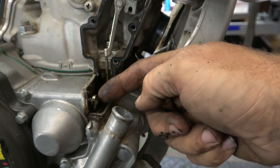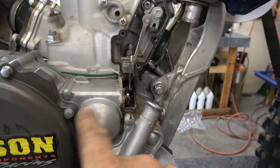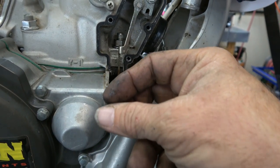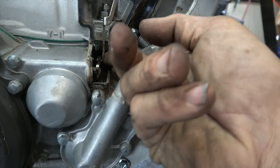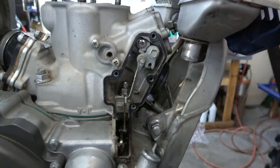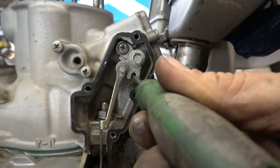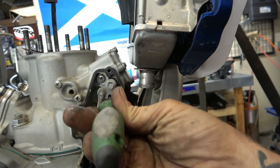The way Yamaha does it: a rod comes down and goes over on a shaft across here. Right here is the power valve governor — it's spinning all the time, and as it spins faster there are little balls that swing out, kind of like a clutch, and they move and lift the power valve, twisting and opening everything up. One thing you want to do — if you buy a new YZ, they give you a little pin that you stick in here when undoing it, because if you try to undo this with an impact you can actually break parts in here.